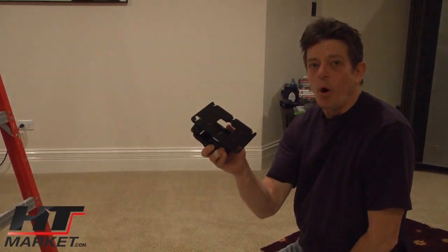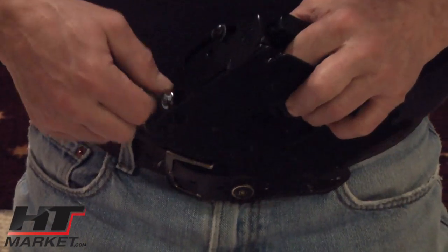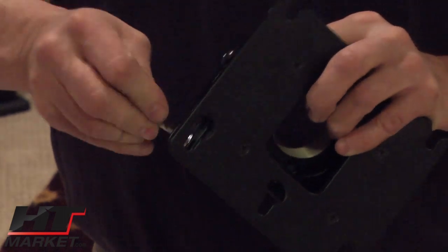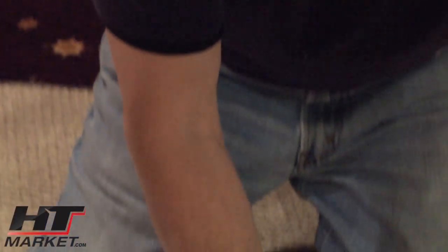We need to mount the ceiling mount on the ceiling. As a means of securing the projector so it cannot be removed, the RPA mount has a locking mechanism that opens and closes around the mounting screws. It opens and closes the mounting bracket so it actually locks on the screws and cannot be removed — similar to the locks on a wall mount bracket for a flat screen TV. So it goes on like this and then you lock it; somebody can't remove the projector. Plus, in case of earthquakes, it won't be pulled off the ceiling.